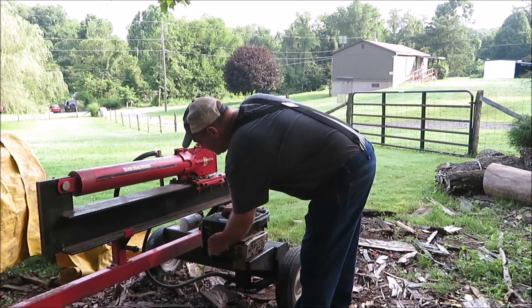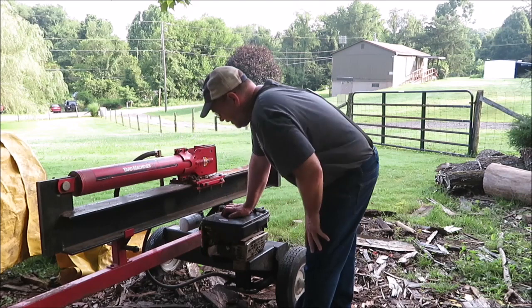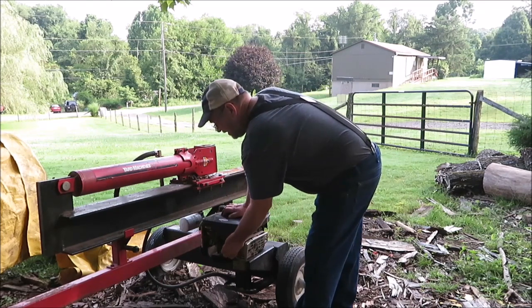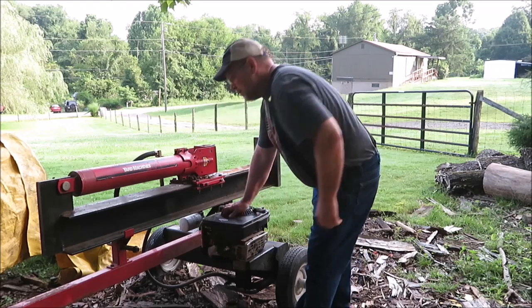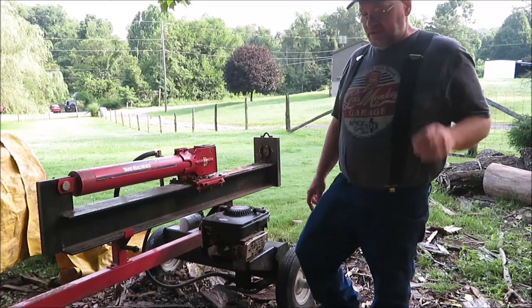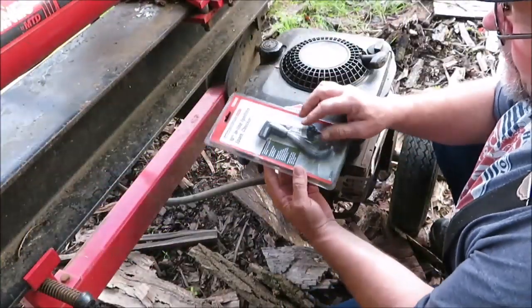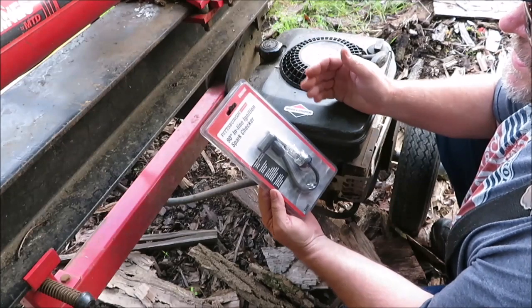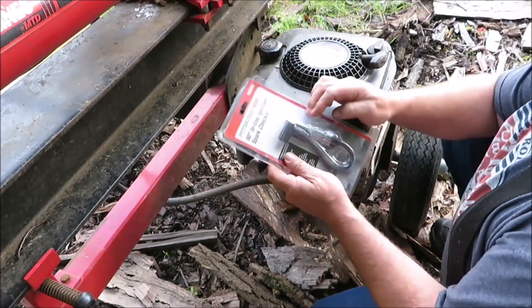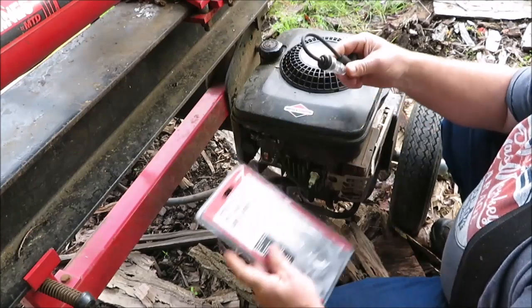No fire. So what I'm going to do is — I don't know if you guys remember, we had them spark plug testers — we're going to check the spark because before I had trouble with the coil on this thing. So I'm going to get a spark plug tester and we're going to see if it's got spark. That's going to be our first thing. I have a couple different ways of checking this. First is just basically a spark checker and this plugs into the wire. If you don't have one of these, I'm going to show you how you can do it without this tool.